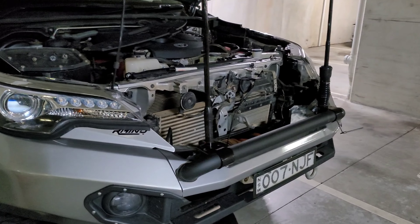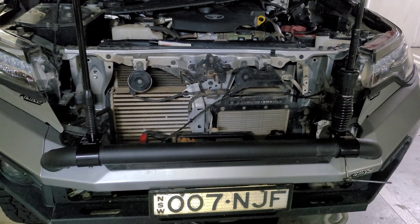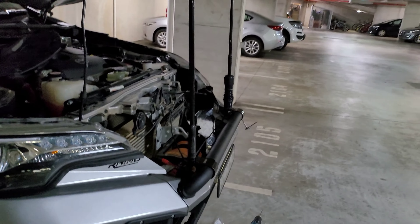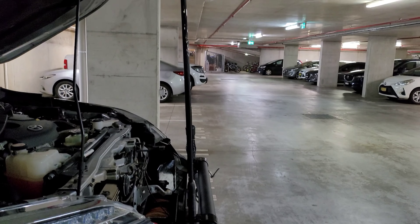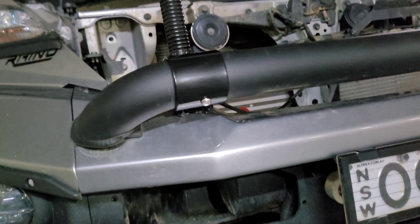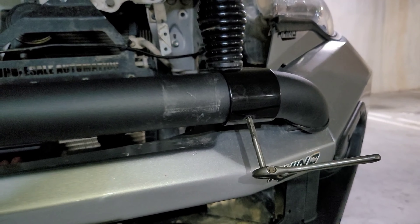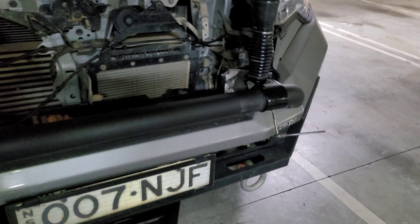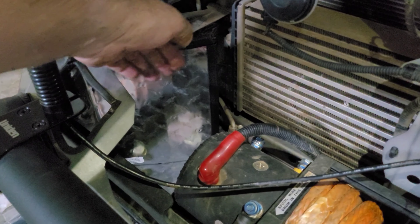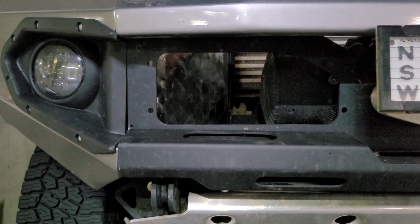Today's job on the Fortuna - remount these two aerial brackets. I had to spread them because I've got a light bar to fit in between them, but I haven't got the brackets yet so I've just spread these and got them exactly in wind. To stop them moving, tapped a thread and put a little stainless bolt in there. In the process of tapping this one right now. We also made some little deflectors in here to deflect the air into the radiator as it comes through the front.